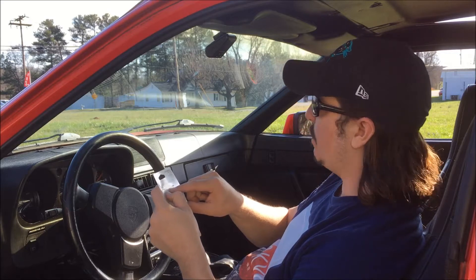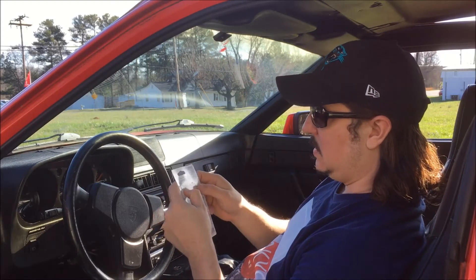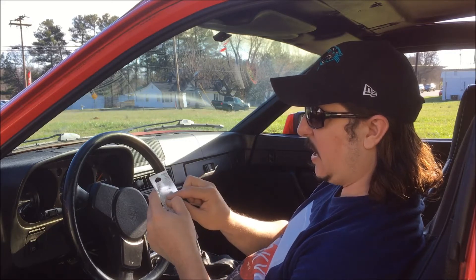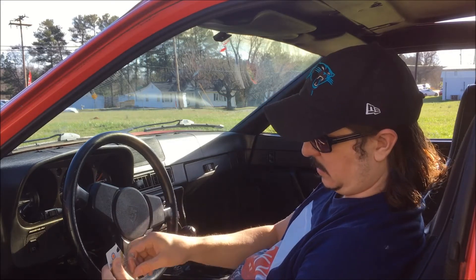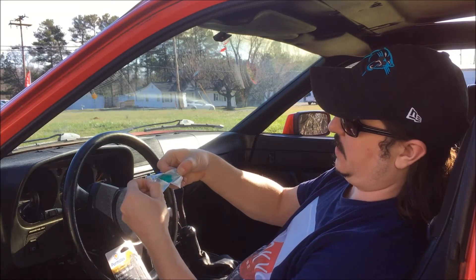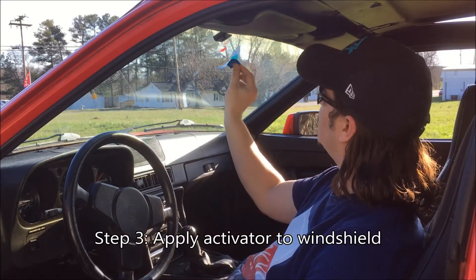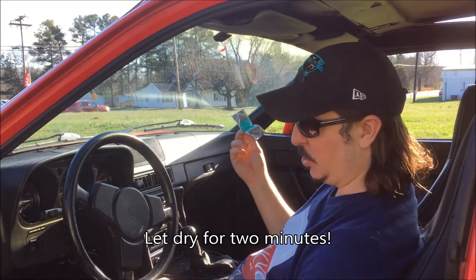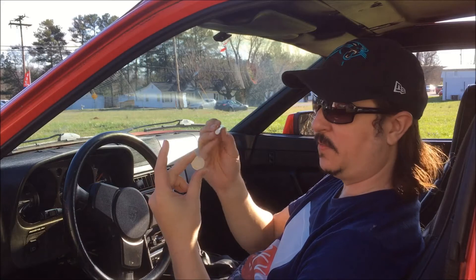On the outside of the windshield you'll want to make a mark, which we've already done. I'm actually going to remove my dash cam so you guys can see this better. Then we're going to open our cleaner and activator and pull back the towelette. Once you have your activator out and open, you're going to wipe it on your windshield and let it dry for two solid minutes. Do not apply it to the button — only the adhesive goes on the button.